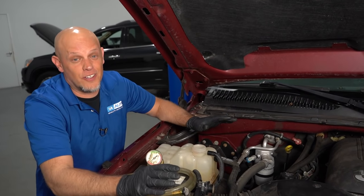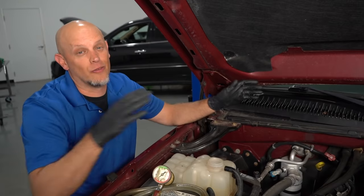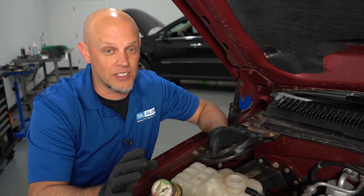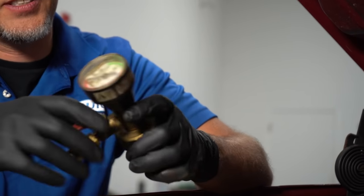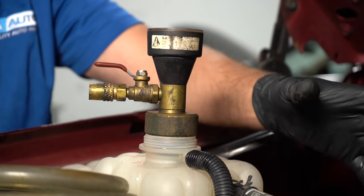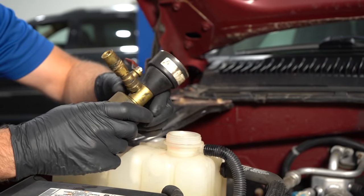And then there are those extremely difficult vehicles to get the air pockets out of. Maybe you even have an engine in the rear and the radiators in the front, and there are a whole bunch of areas where air pockets can happen and hide around corners. In those extreme cases, you can use a tool like this — this is an airlift system. Basically, when you put this on, we're going to put a vacuum on the entire system: a vacuum in the engine, vacuum in the radiator.